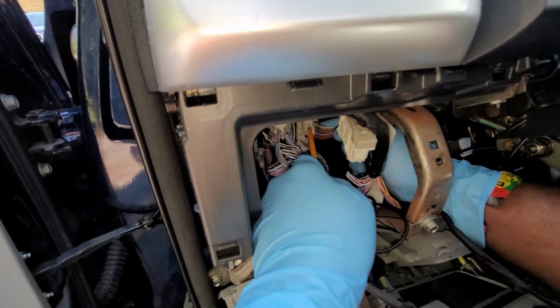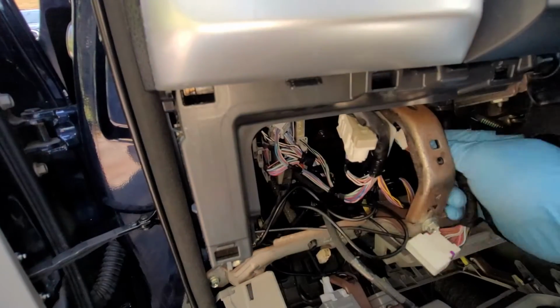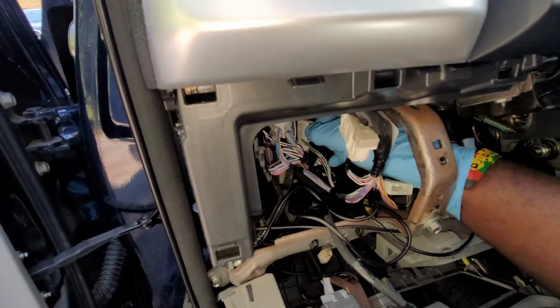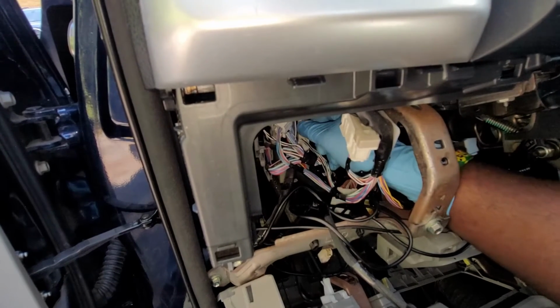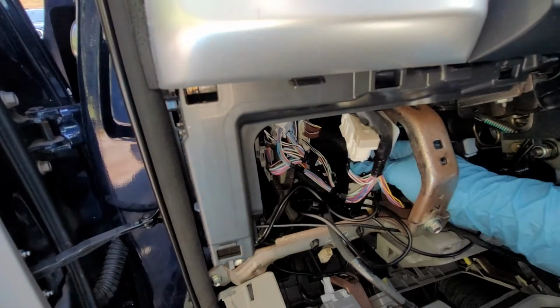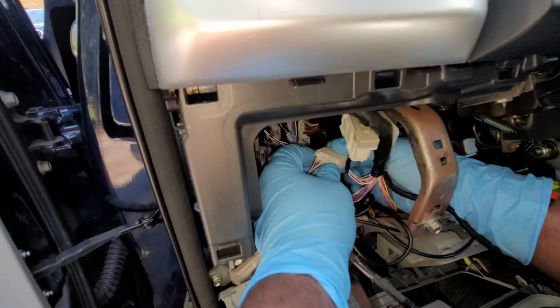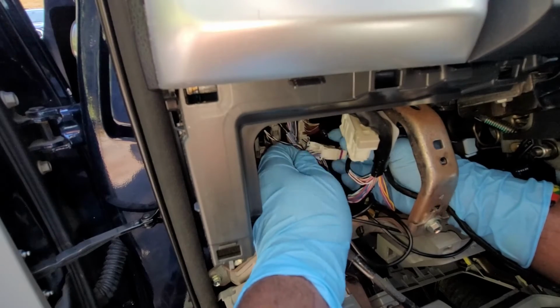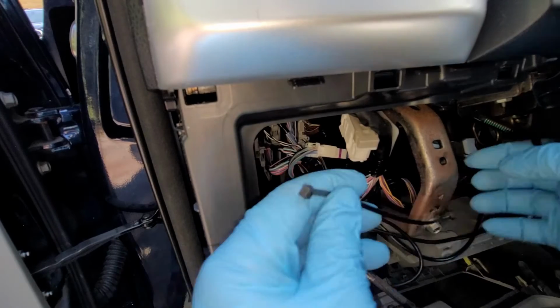The connector is now out and it's time to carefully connect the wire harness while avoiding breaking any of the pins. Connect the wire harness to the ECU, then connect the factory connector to the wire harness. Secure with one plastic tie strap and clip the end.